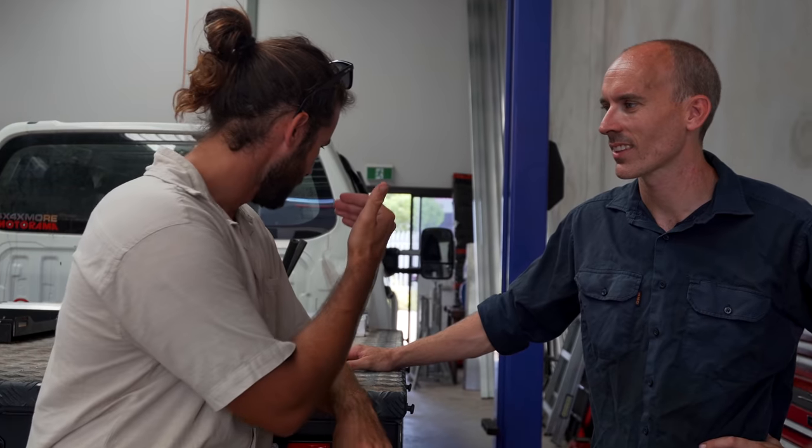The reason for us doing it, guys, basically, is because we want to get our rear wheels directly in the center of our load. It'll just increase the load carrying capacity of the car. It'll do it more comfortably. It'll be a lot safer and we'll have zero chance of the chassis bending. So if you guys in the four-wheel drive scene, you definitely would have seen a lot of photos of cars that are bananas. We don't want that happening, but that's the reason we're doing it.